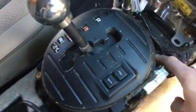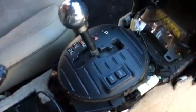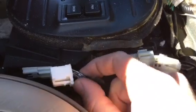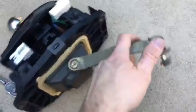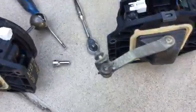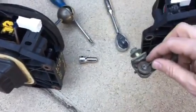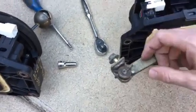From this point, you've got four 10mm bolts — one on each corner. Once those come off the shifter assembly should pull right out. There are also two electrical connectors that have to be undone before you can officially pull the shifter out. The old shifter assembly is out — just to show you what I was talking about, this piece right here just flims around all by itself without the stick shift engaged, so that is busted. Before transferring, I'm going to move this little assembly over by pulling the pin out and transferring everything over.